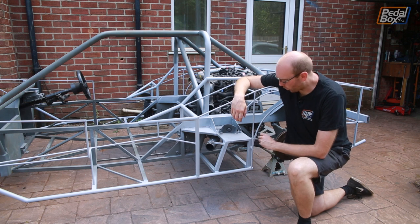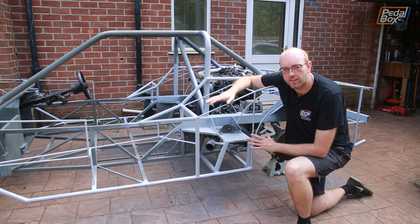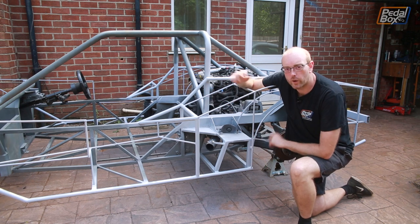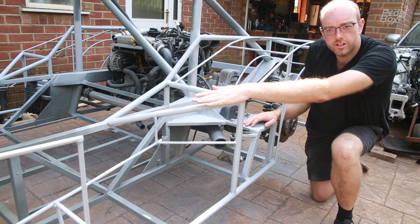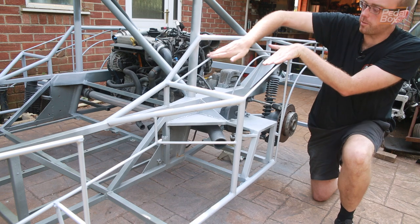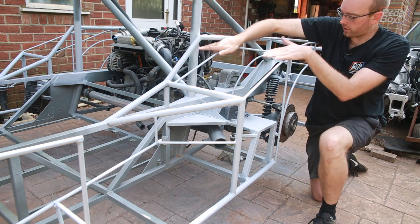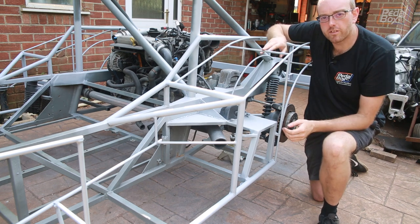Quite a lot of stuff has happened — I've added quite a lot of metal onto the back of the car and built these arches out all the way to the back. Unfortunately I just wasn't able to design, make, and document it in a coherent fashion at the same time. This fairly rigid section at the front end of the wing is essentially going to be a bum plate, so that you can sit on here and slide in and out of the car. The body line comes straight up across the top of the arch, and this framework forms the very edge of whatever body we end up putting in around the top of the car and the roll cage, while the inner arch structure sits on the inside.